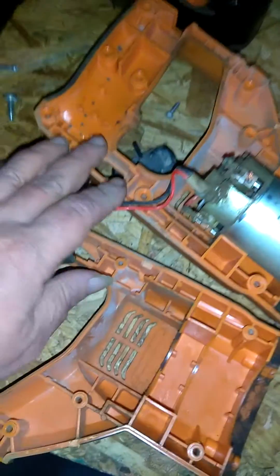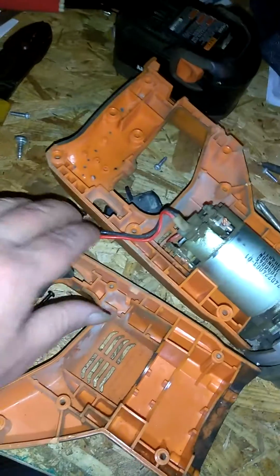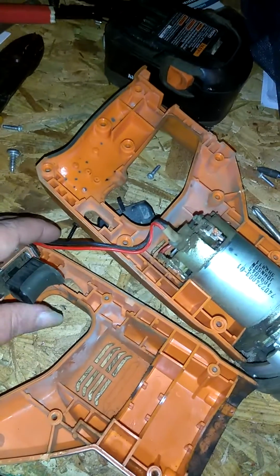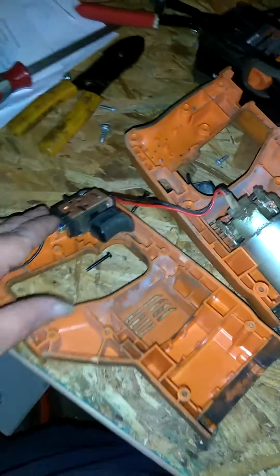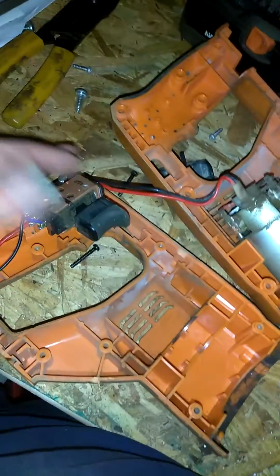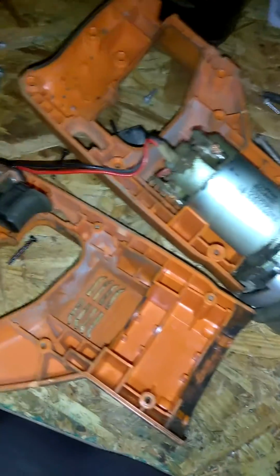Now, this would be sort of like a switch you would put in that one for non-variable speed control. You would take and connect your black to black and red to red. This is pretty simple. It's not a whole lot to it. Same process. Take and connect your wires with butt connectors, and if you like, you use heat shrink wrap on them after you got the butt connectors on and crimped. And if you use solder fill, you'll have to heat the connectors up, but I'll go into that later.